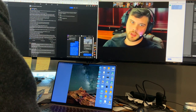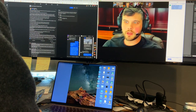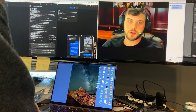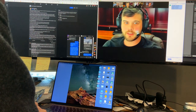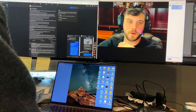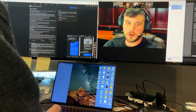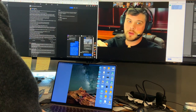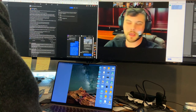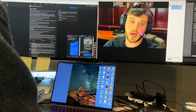One thing that I really love about the collision avoidance is it's very smart. So say you're going really, really fast towards an object, the collision avoidance will engage a good distance before you get to the object, in accordance with what you have your active braking set on. If you have your active braking set to be very aggressive, or slow, or very sensitive, either or, it will actually, depending on your speed, determine when it actually needs to brake. And on the other hand, say you're going pretty slow to an object, it will let you get very close to the object because it has so much control at that speed. So it's very smart, intuitive collision avoidance that seems to sense a lot, picks up a lot.